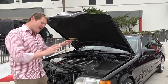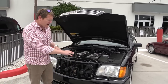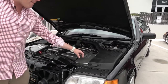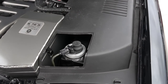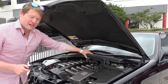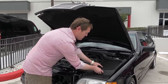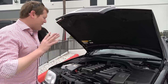Around 1987 there was the facelift of the 600 SEL. The later cars had a slightly smaller ABS ECU, other changes, and the five-speed gearbox as opposed to the four that had come before. But this needed more than just what you think. To make the larger airboxes here has required the suspension oil reservoir to be moved, new pipework, new air conditioning pipework as well, managed around to all fit around the engine to enable this, to make it all possible. And the engine itself has had all sorts of different changes in terms of the new stainless steel exhaust system and just about everything.